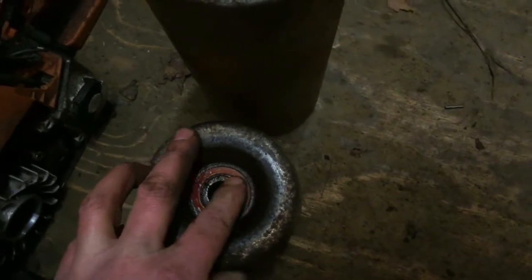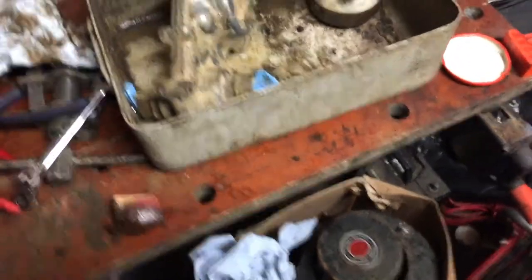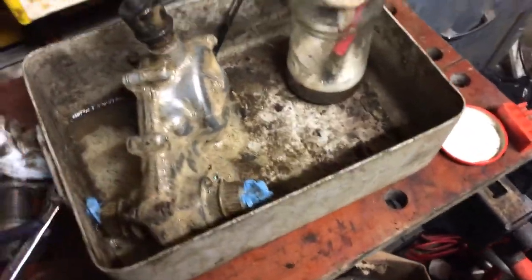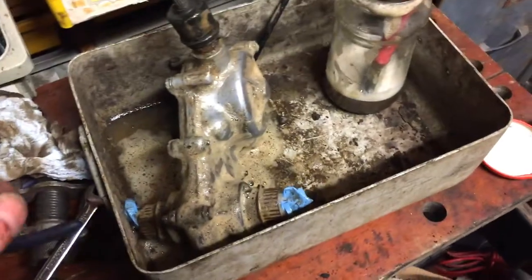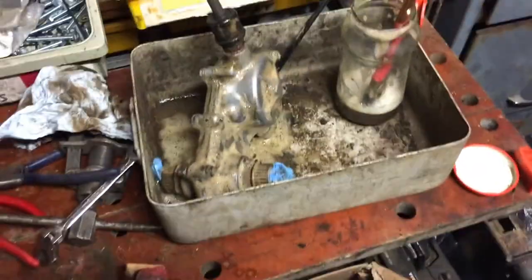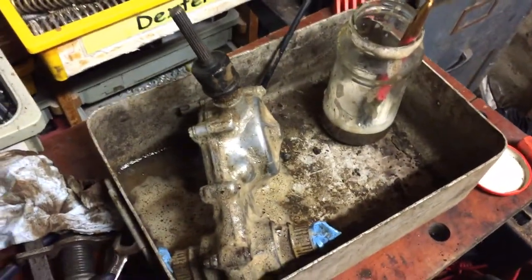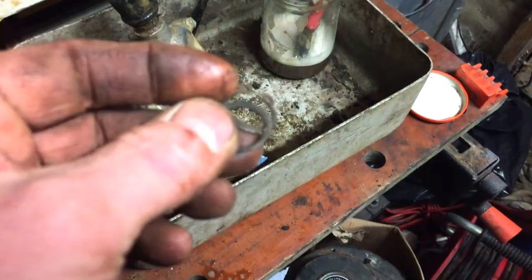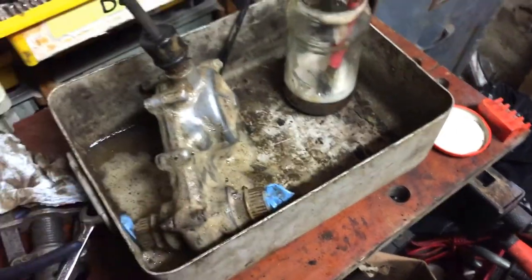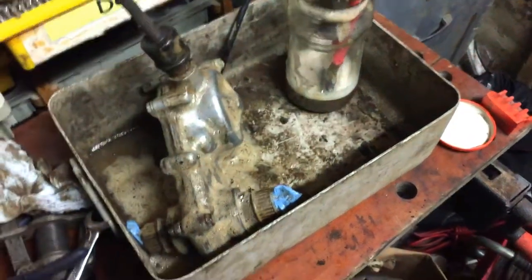That one's a little bit noisy but there's no play in it so I'm going to leave them — I haven't got the press here either. If there was lots of play in them I would definitely change them, but they'll go again. I'm just waiting for the degreaser to do its stuff and then I'll put it outside tonight and give it a blast down with the hose. The shaft is clean. I've got some new spare bits — I should reuse the washers as they're in okay condition. The circlips aren't bad either but I have got new ones so I'll use those.